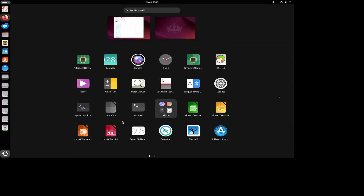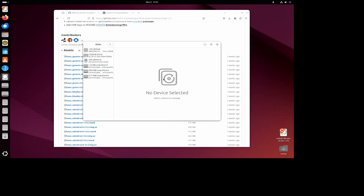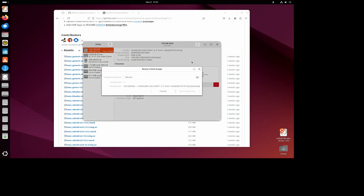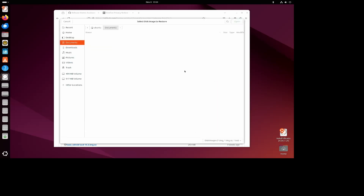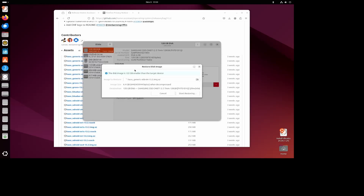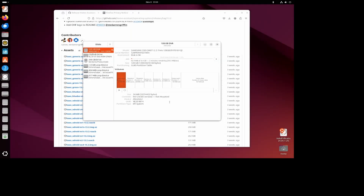Now I'm going to look for Disks — it's in the bottom left, then in Utils, then Disks. The disk I want to overwrite is the 128GB disk, so I click on that. Top right I click 'Restore Image', then go and find the file I downloaded in Downloads, select it, say OK. It says the disk is the wrong size but that's fine — I say yes I want to do it, click Authenticate, and away it goes. We'll see the progress bar going across.